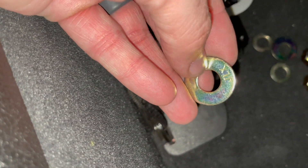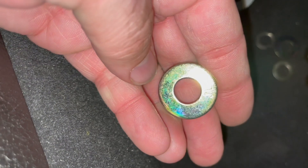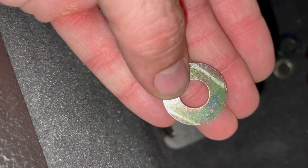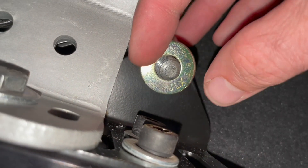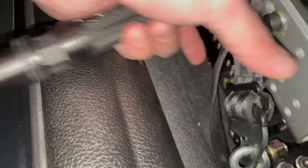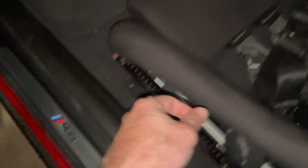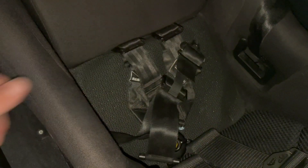The wave washer goes on here with a regular washer — make sure it's installed the right way. Washers have a direction: there's a rounded-off side, sometimes with lettering, and a sheared-off side. The rounded-off side faces outward, so it looks like this. At full tension it's going to be torsionally pulling in one direction, and this eyelet is not going to spin, so there's no movement in the belt whether the car rolls over or gets into a frontal or rearward impact. That's a big thing.